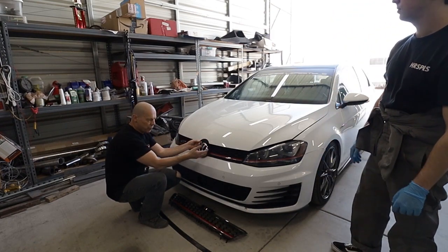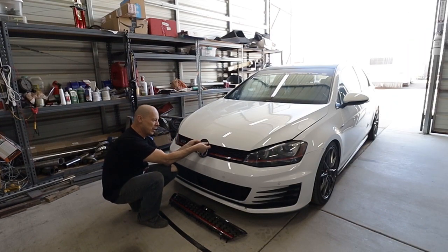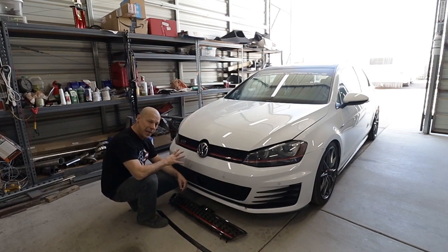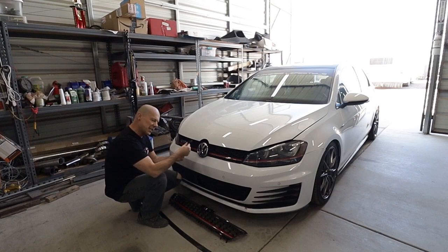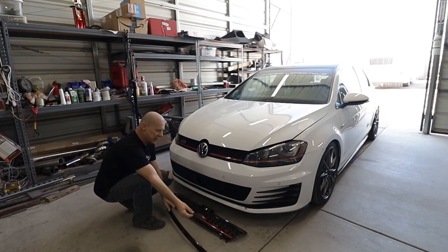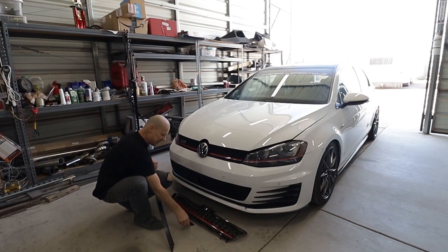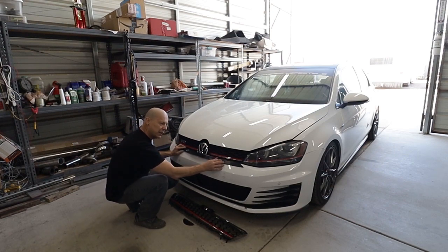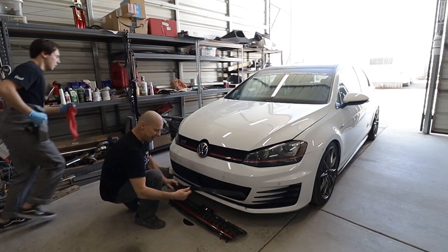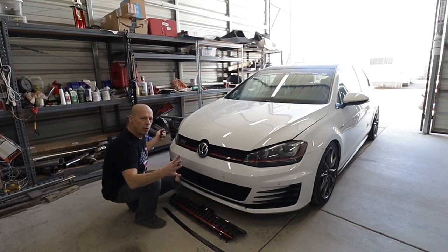You'll still have a little line right here, and that's fine if that's all you could do - most people probably wouldn't even notice that line. But we're custom around here and we want to make a steel piece welded in, which is going to require grinding this hood right here and having the entire hood repainted to match. I think that's the right way to do it. We'll weld it in - it has to be out of steel. Then what I'm going to do is actually use this piece down at the bottom here and plastic weld it into the bumper, to get rid of that little half-moon shape down there.